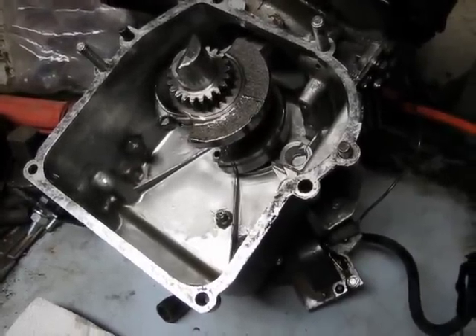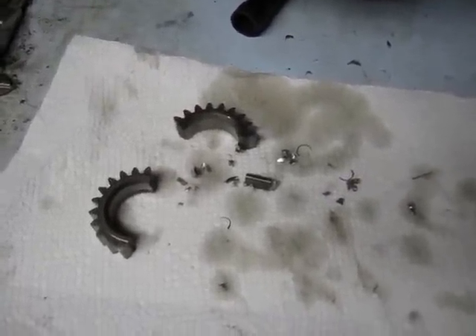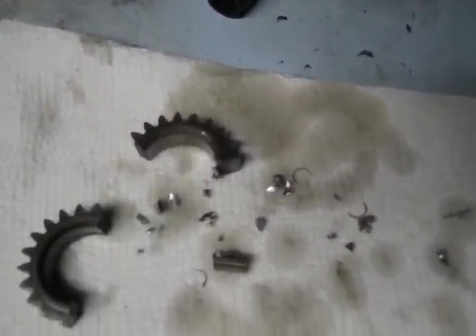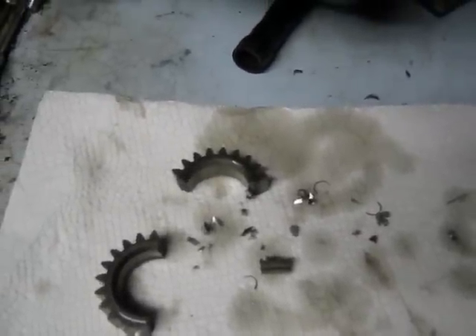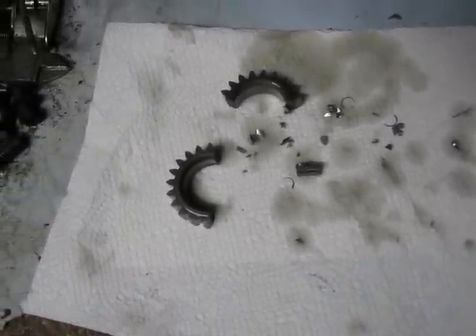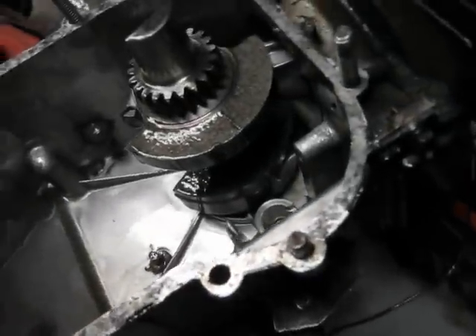I've got the engine all torn down now. This is number one cylinder. The only problem I've found so far is this broken crankshaft off of number three cylinder. It broke at the key where that comes through, since that would be the weakest point - broke a full tooth off. I've got these little spirals that look like thread pieces, and some chunks of the block where it slammed the gear around into it. Other than that, the engine appears to still be okay. If I hypothetically put a new gear on it, it'd probably run. But seeing what it did to this one, I'm more inclined to build a whole crankshaft with an integral gear like number one. I still have to determine what I'm going to do.